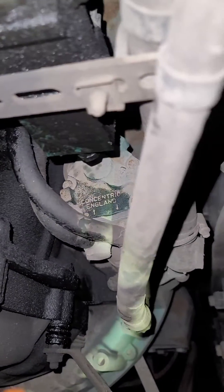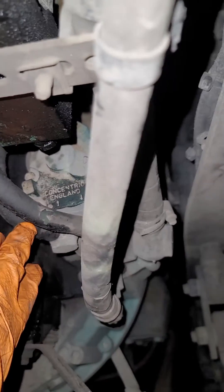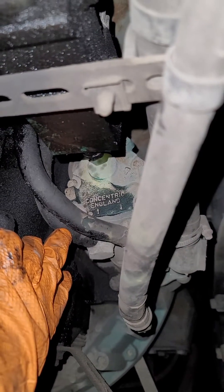It has two lines: the one going in comes from the little priming pump, and the one coming out goes to the fuel filter, and from the fuel filter it goes to the high pressure rail.